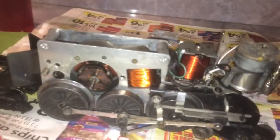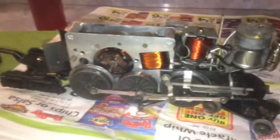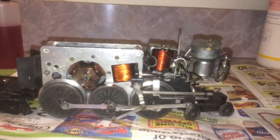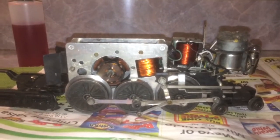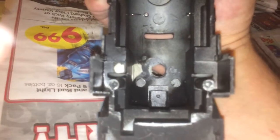The brushes are about yay big — there's about an eighth of an inch left on them. I've really never had to do this before. There's only four screws; it's real easy to take apart. You'd think they would be harder. Definitely on the post-war ones, your 675 is probably going to give you the most headaches — that one's not real fun to take apart. But these basically pop off with those two right there and those two right there, and you've got it off.